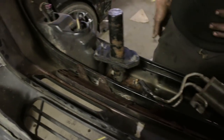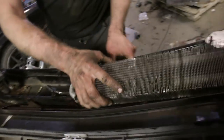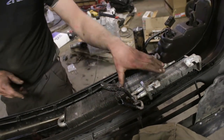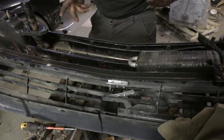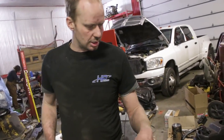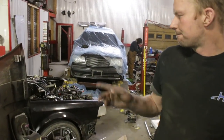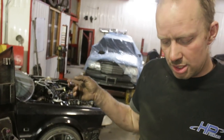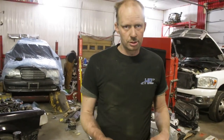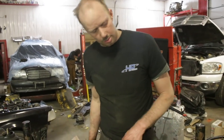I think these small coolers will fit over the opening here. If we notch a little bit into the plastic and cut it more straight, we can beef it up with fiberglass afterwards and lay the coolers in there. As for whether there's such a thing as over-cooling — basically the only thing we can do is drive it, pull over, and use a temperature gun to see what each line is doing. We'll probably put a transmission temperature gauge in it, and it's as simple as turning the pump off if we're over-cooling.